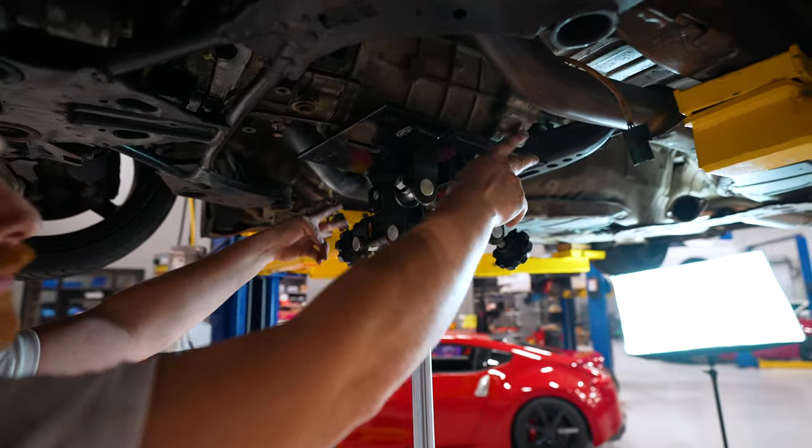Cool, so what I was talking about, adjusting it off the floor, this is your clutch master cylinder. So this bolts through the firewall. So your engine bay is up here, rest of the car is back here, and then this is the clevis that goes to the back of your clutch pedal. So as you press the pedal down, this plunger goes in like that, right? Pumps fluid, will work. You got a 12 mil right here. So it's really hard to show under the dash. We'll try to show you as best we can, but you just back that 12 mil off,